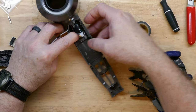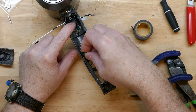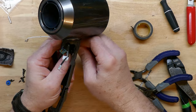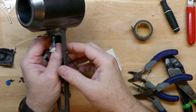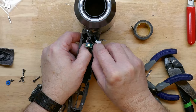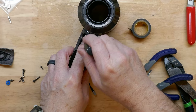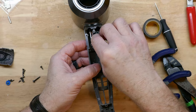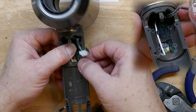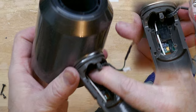We need to get the wires in place. I'll take the black wire and go through first, making sure we have plenty of length, then the white wire. The white wire also has to sit in the little groove beside where the switch is. There's a tab on the left side of the switch that's going to go over the white wire. Now the white wire and the little ribbon that goes to the board are both under that tab.